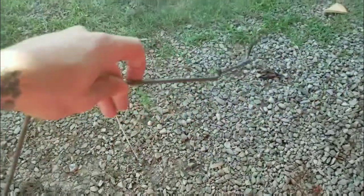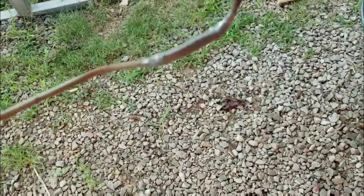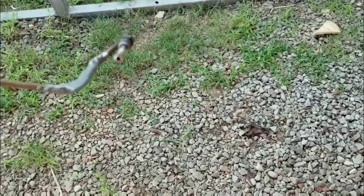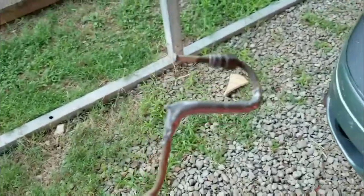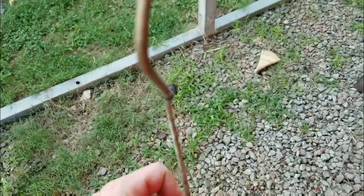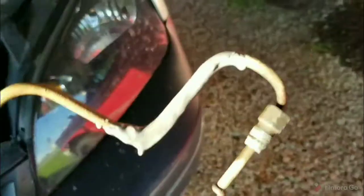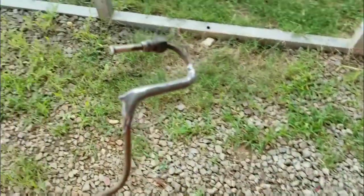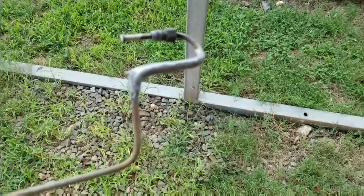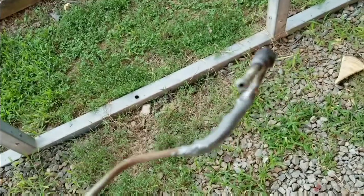I actually took it off the car because you can't get pre-bent brake lines. I JB welded it — this is the original JB weld, two coats, maybe 36 hours after the original coat. When I first took it off the car I brake-cleaned the entire thing, used gloves so I didn't put any oils onto it. I coated it twice: first coat, let it set over 24 hours, then a second coat. JB weld is rated at 5,900 PSI and 550 degrees Fahrenheit. There's no reason why this fix won't work — I'm just doing this video to see if it does.